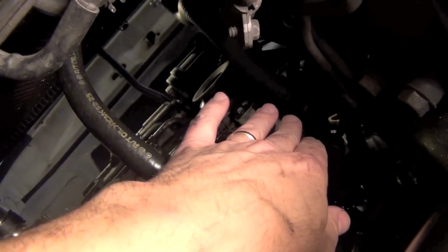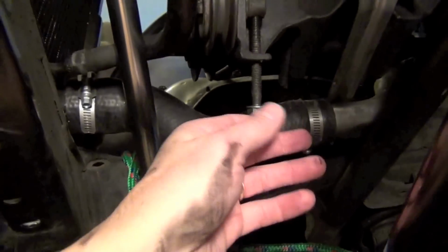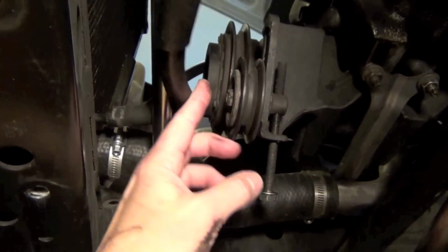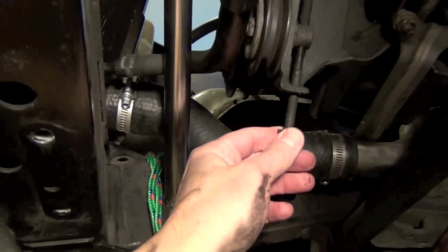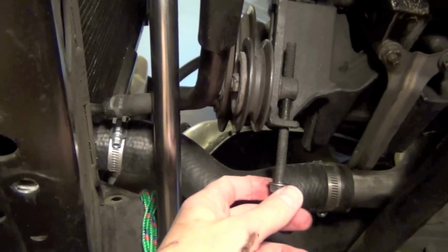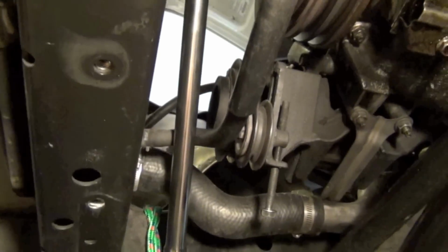It really helped. Oh, while I'm down here, I actually loosened my alternator belt right here from underneath. You got to get that front screw, and then your whole alternator will swing when you loosen the top bolt. Also, for your air conditioning, this is the pulley right here. But you remember, you got to loosen the front bolt right here on the front to make it let go of its pinch. And then this is just an adjuster to get your belt right, and then you would always tighten this back. So you start by loosening this, then you really don't have to do anything with this. It just lets it slide. I took all my belts off from down here once I had the fan off.